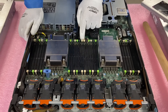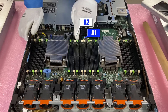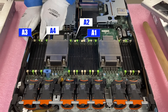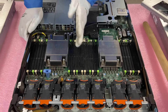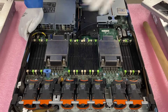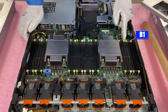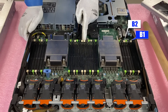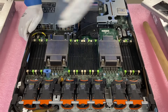What you'd want to do is start here at A1 — this white tab. Then come back here to A2, the next white tab. Over here is A3, the white tab on the outside, and then A4, the white tab right there. So if you were putting in four 16-gig or four 8-gig modules, you would put them in the first four white slots — that's the proper way to do it. Now if you're putting in eight DIMMs with two CPUs, you'd come back over here. This outside one is B1, then this white one right here is B2, then over here the outside white tab is B3, and this is B4. White is the start of the channel, so if you're putting in eight modules, put them in the eight white slots.